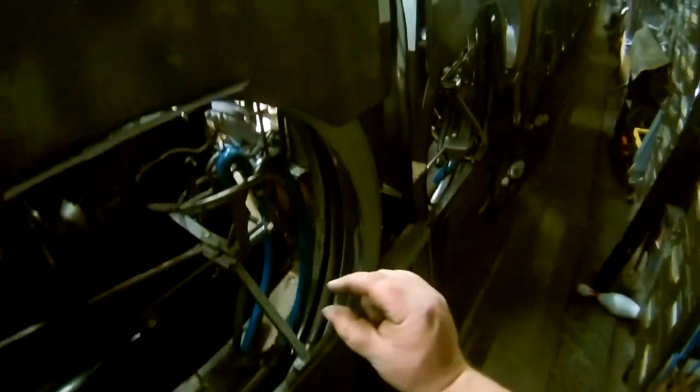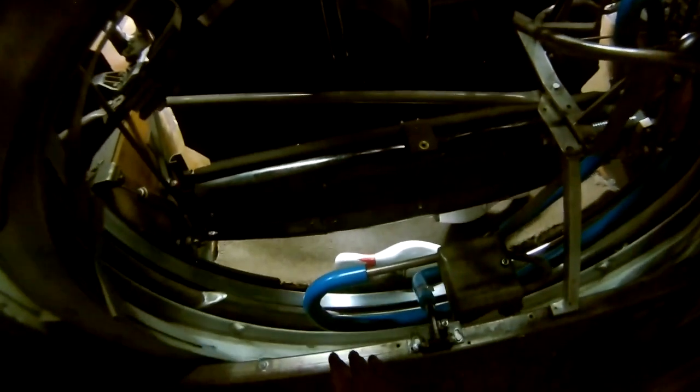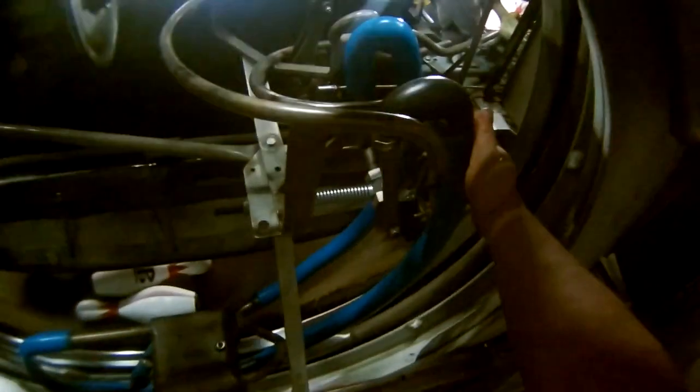Again. We have one kicker, and it's that tiny thin strip, too. It's only half inch wide. It's a thin kicker strip. That's all that's contacting the ball wheel. We got one kicker. We got a little bit of pressure when it hits here. We have a little bit of pressure with here. And we have perfect ball return. Absolutely flawless. So I'm going to close this up.